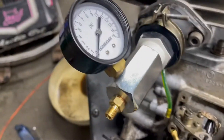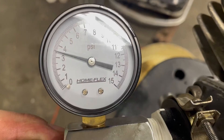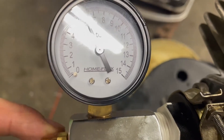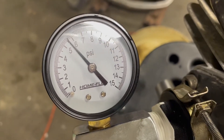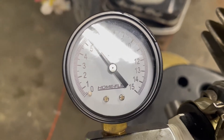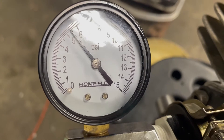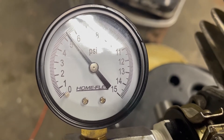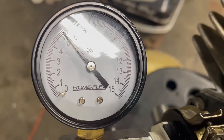PTO side seal is in. Flywheel side — spark plug in, remember that rubber piece over the exhaust — and we'll give it a try again. It seems to hold pretty darn steady, maybe a slight drop over time, but she's good. There'll be no issues running this motor, no air leaks — pretty solid.